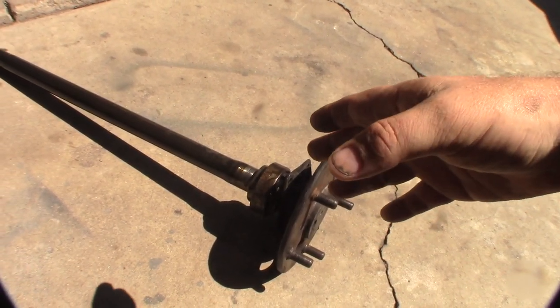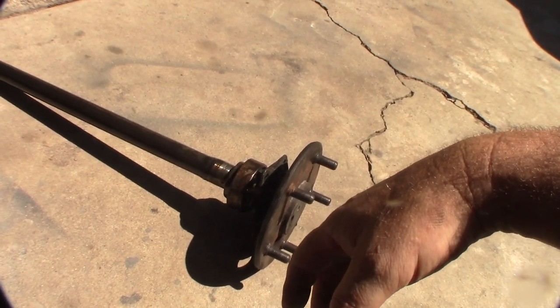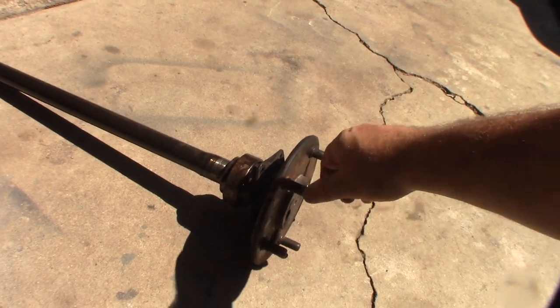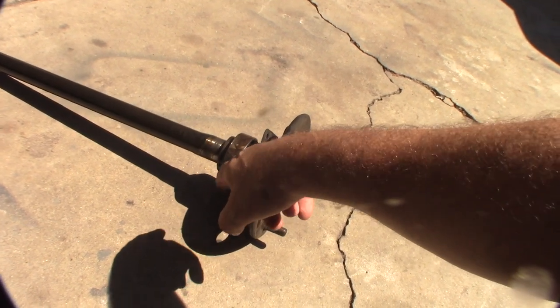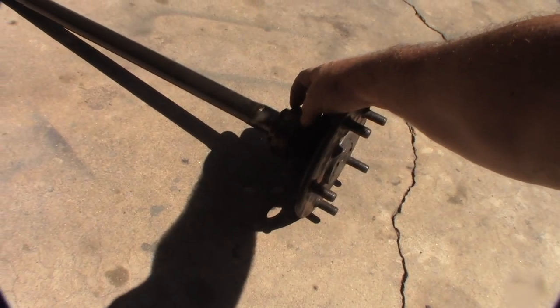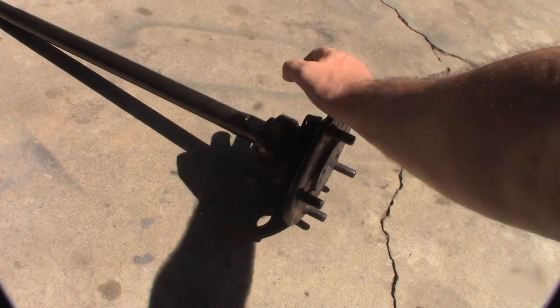What happened was it kind of got out of place and allowed the oil to start leaking out. So if the oil had never leaked out, I wouldn't have known the bearing was so bad. It didn't feel bad — I was shaking the tire — but glad I saw it. I wasn't driving around like that. This has been failing for a while. The bearing is loose — definitely not good. But the retainer is all the way in there, so it wasn't a complete fail.